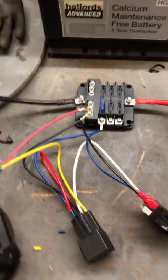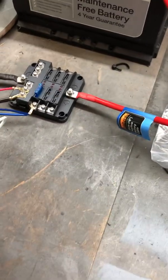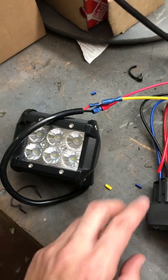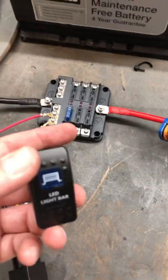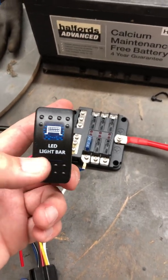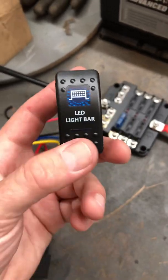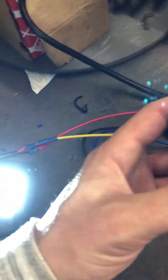Welcome to the next installment of exciting rocker switch wiring. I wanted to have an LED light bar illuminated switch. I've just slaved it with a little tiny LED light for now. I really wanted to have this illuminate the LED section when I switch the light on, and you can have this lower light come on with the dashboard lights.